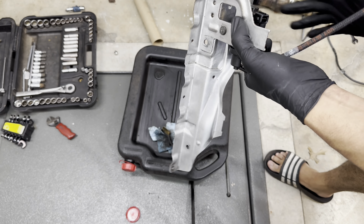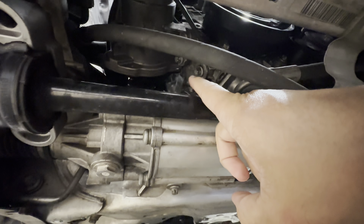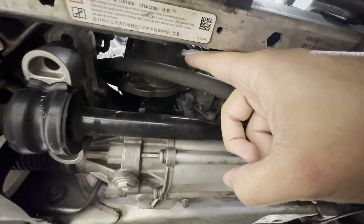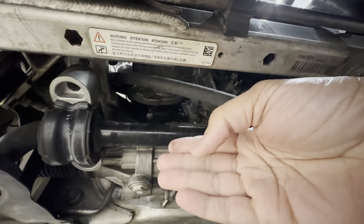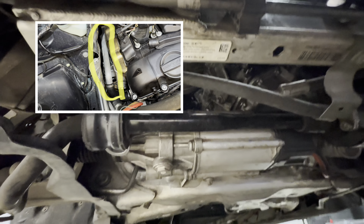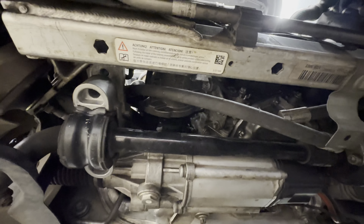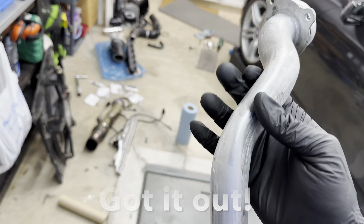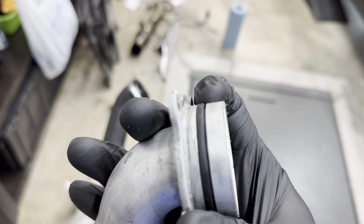This is much better — I'm okay with this. I already lowered the sway bar. I got a little play there because I need room to get to the mounting bolts for the water pump up there — two down here and one on top. I'm not taking the water pump all the way out; I just need enough room to get to the clamp for that metal pipe we pulled off the block. Unfortunately, that clamp is pointing down and I have no way to get to it. You can see the condition on this O-ring — it's pretty flattened out. It is the original. I'm glad I'm taking care of it now.